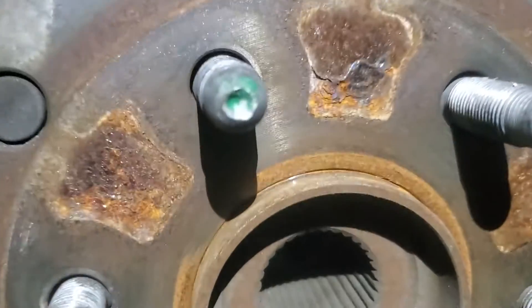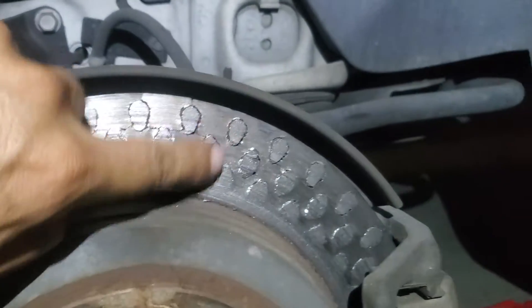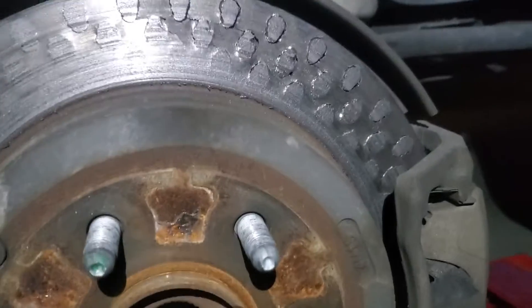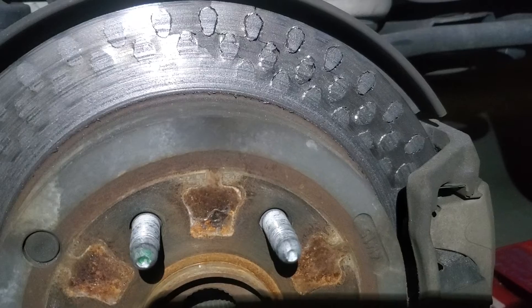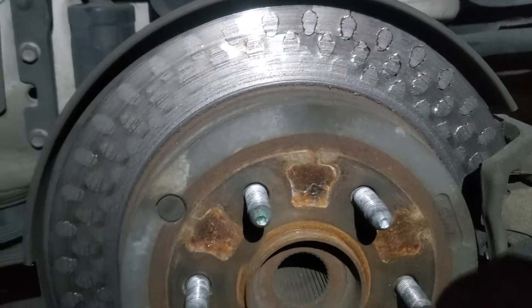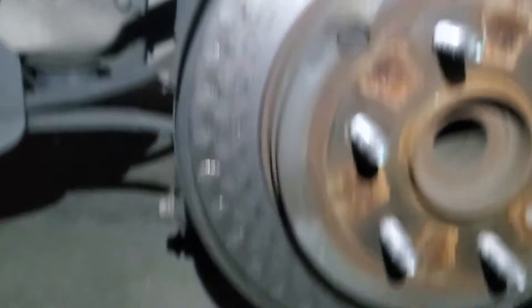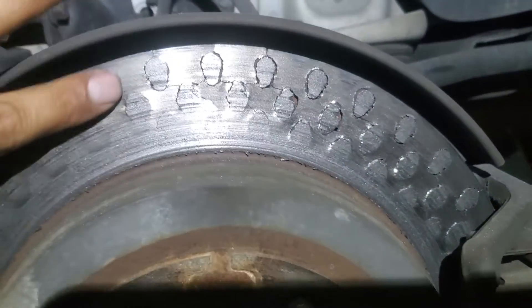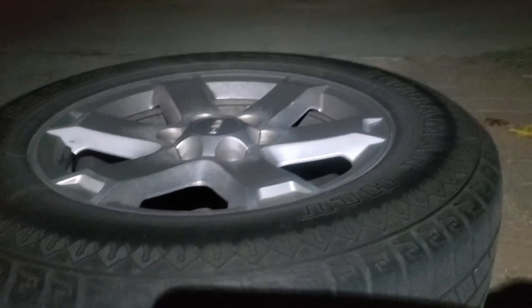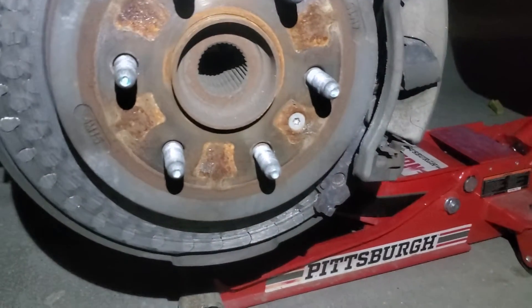There are two really thick blades, and in the middle you'll have studs or fins that allow air to flow. Sometimes they'll be angled, like the blades of a fan, so they can draw air in from the center and push it out. They're cycling air and that helps your brakes run cooler. The reason you can see them now is because all the metal that's supposed to cover them has been worn off and turned into dust.